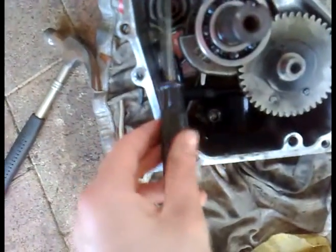There's a little c-clip — I'll put it on a white piece of paper so you can see it better. That c-clip goes around the little shaft in there and holds the gear on. To get it off, I got a flathead screwdriver, put it in there, smacked it with a hammer, and pried it up. Then I got my pliers, held the gear, wiggled and pulled, and it came right out.